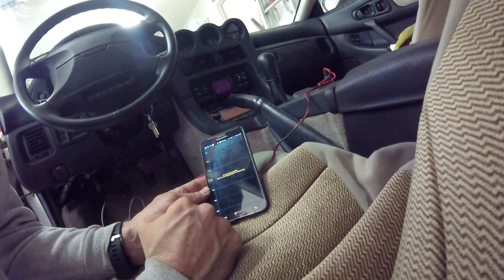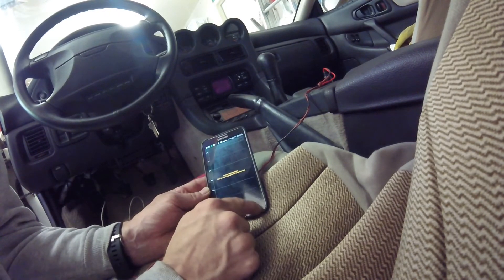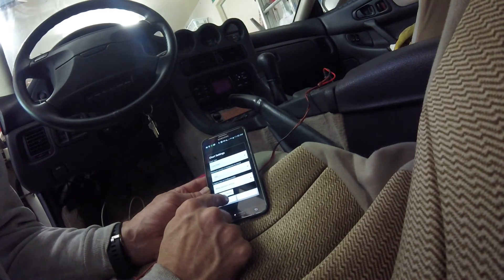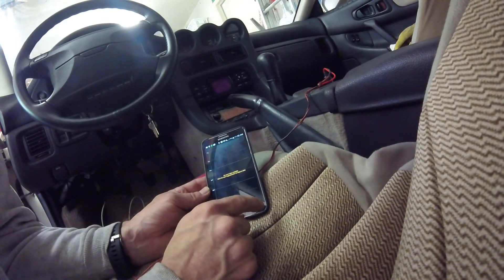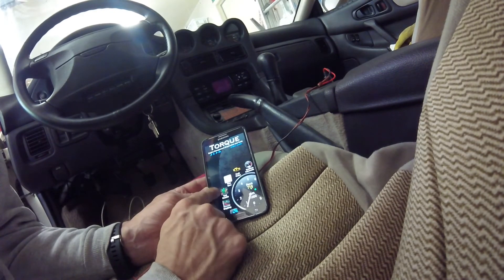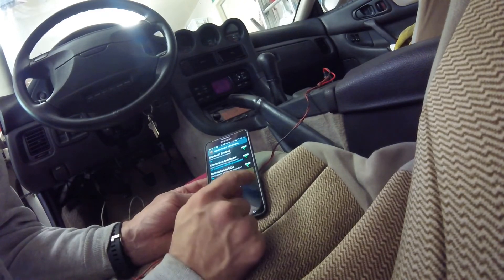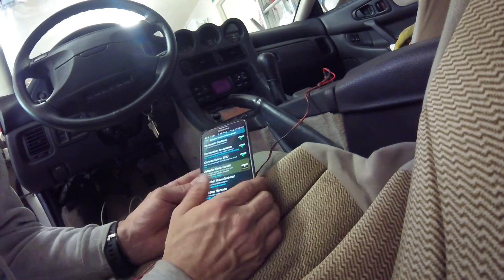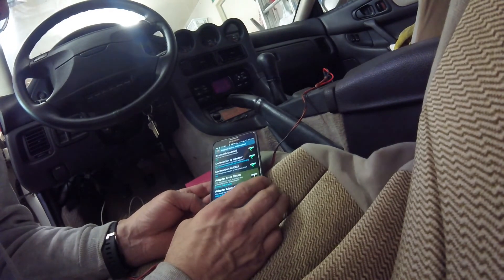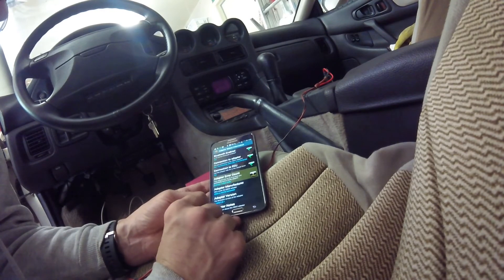Click the start logging button to capture data — I'm not sure where that was, that would be great. I think I might have overstepped my knowledge limits here. There's an adapter error count — that's interesting. This should stay on zero; if not, you potentially have a faulty adapter. So I might be getting some odd stuff going on, I don't know.